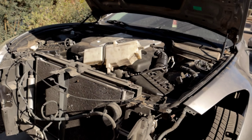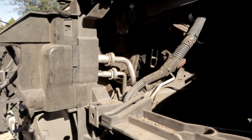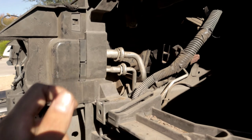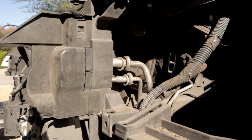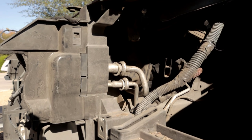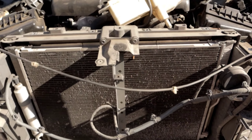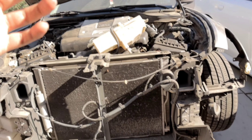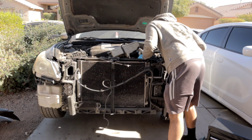I did remove a few parts out of the way. I did want to stop the recording here so that I can show you guys what needs to be done to remove these AC lines. I've seen on YouTube that some people go ahead and cut this out so that they don't have to disconnect it, but I feel like that's kind of silly — I would rather just disconnect these lines. These are quick disconnect lines for the AC. It's important to note that you guys need to drain out your coolant system, and on this vehicle it has already been done. The AC doesn't even work, so I'm gonna go ahead and disconnect that. My brother's here and he's actually gonna help me out — he's actually done this on his G37.